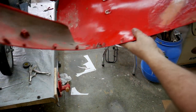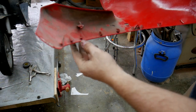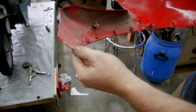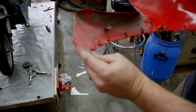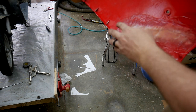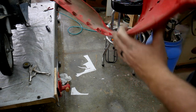I don't really like this as a material for scooters. I think it's a styrene because it's so brittle — if it was ABS it would have a little more give. There's supposed to be a tab right here and that's completely broken off — that's an alignment tab. All of these tabs up here are broken off too, and these are what hold this front fairing to the front of the scooter.